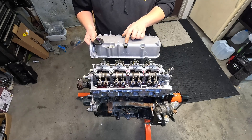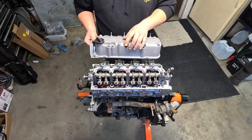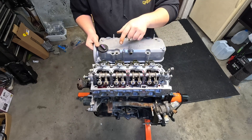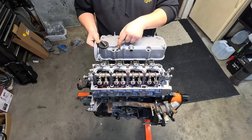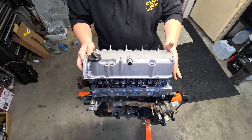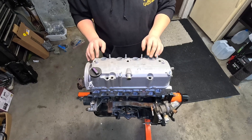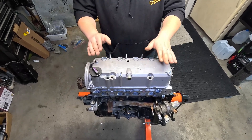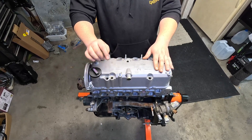Now one of the other big differences you'll notice is this valve cover has a much bigger breather — I believe this one's 19 millimeter or three-quarters, so much bigger than the breather on the D16 valve cover. Now the most important difference for our situation is that this valve cover has a spot for a dipstick, because on the factory D17 series engine the dipstick would go into the valve cover, through the cylinder head, through the block, down to the oil pan. So let's go ahead and set this on here — everything fits perfectly just like our D16 valve cover would, and you can use all of your hardware as far as bolts are concerned. This thing will bolt right up and be a perfect swap, and now the only thing left is to check if our dipstick will go through this hole without any obstruction all the way down to the oil pan.